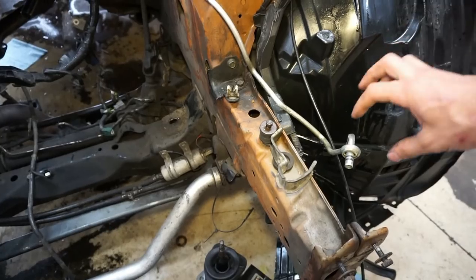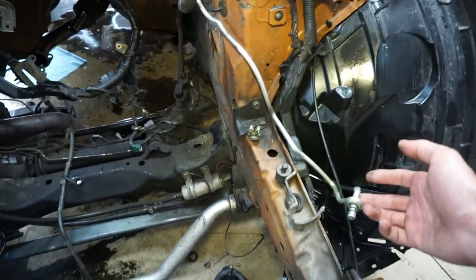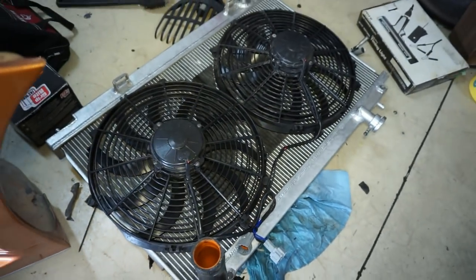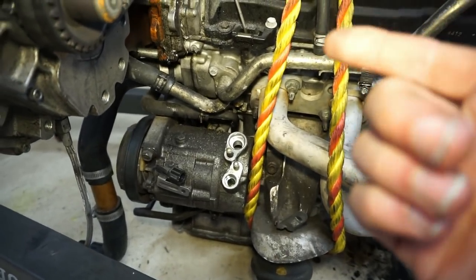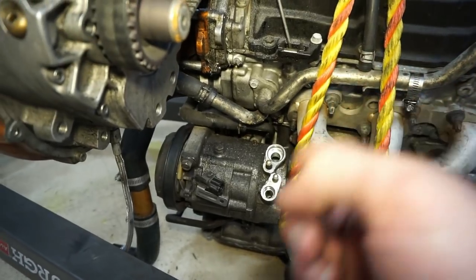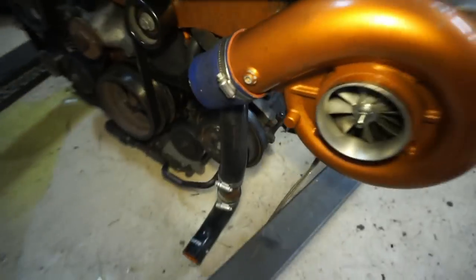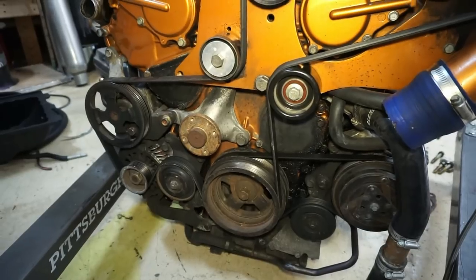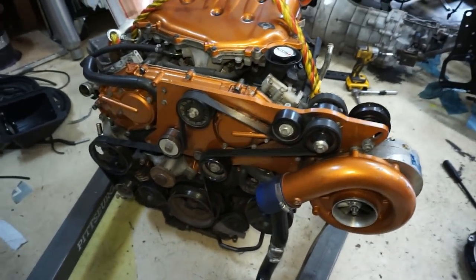I was also pretty careful to make sure I didn't mess up any of the AC lines or the power steering lines, so that stuff's all going to stay. I want to try to keep heat and AC in this thing. I'm going to try to use the same radiator — it does have the AC condenser bolted right to the front of that. This swap is common enough that they actually make brackets for all the stuff, but it's like $400 for the bracket, so I probably won't spend that. I'd like to figure out a way to use a 350Z compressor bolted to the LS, make a bracket for it, and try to keep power steering, AC, and heat.